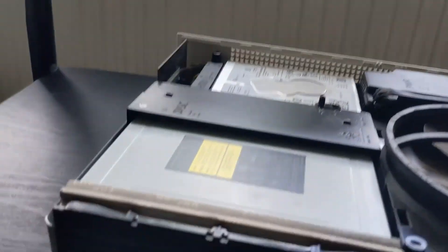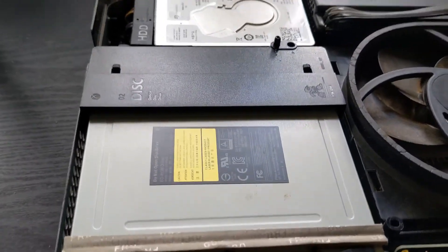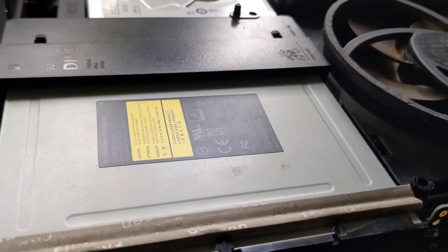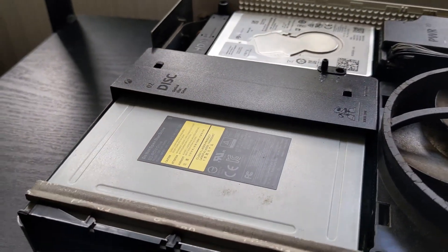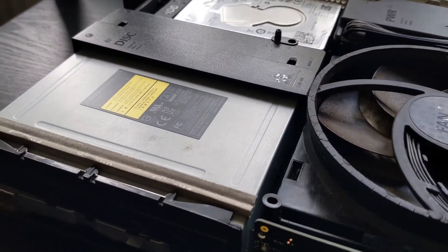In the disk drive you have a logic board which is hard-coded to the console it's in, so when you put in the new disk drive you need to make sure that you've got the logic board from the old disk drive and put it in the new one. The logic board has a motor soldered to it, which is where these videos tell you to desolder and re-solder the motor. But like I said, if the motor is fine you don't actually need to do that.